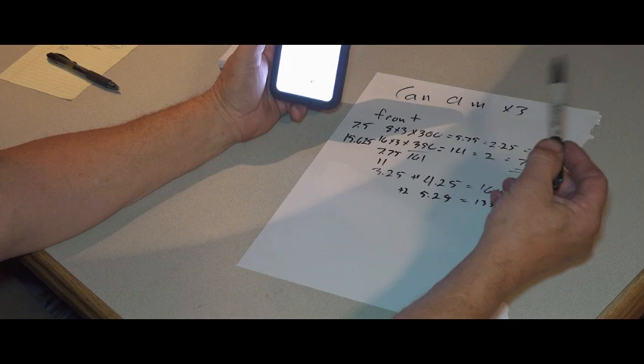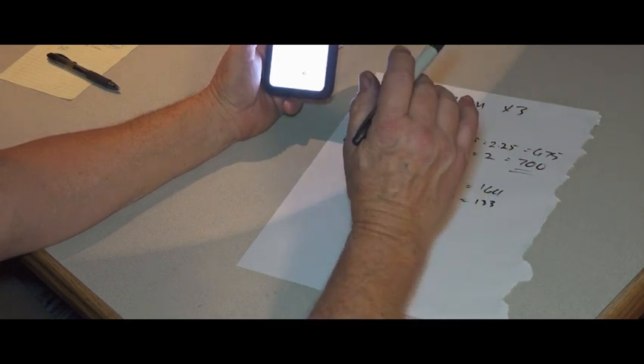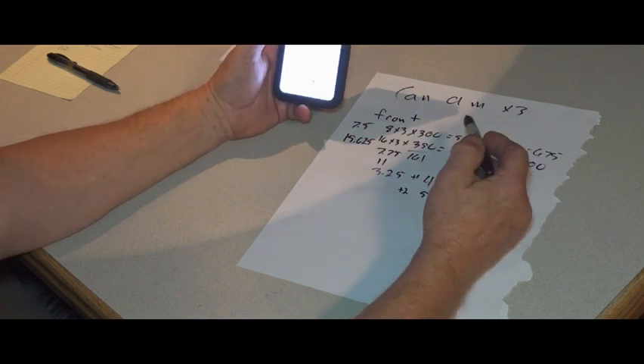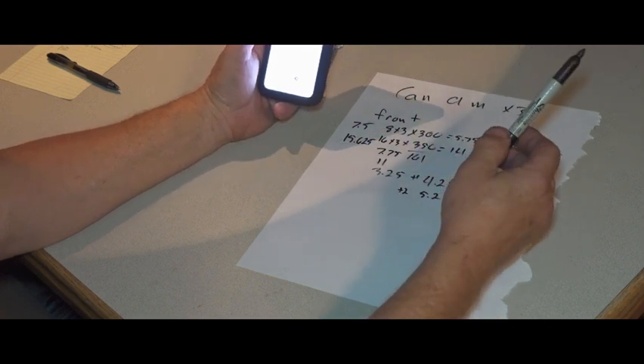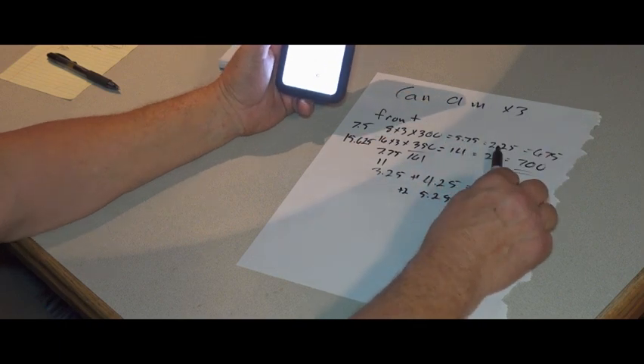We also know that this car had a 17.75 inch under-skid-plate ride height, which is right where it should be with a 35 inch tire. We're close enough on the front spring — we're going to go run it and start working on damping, valving, and other tuning things. So that's it.